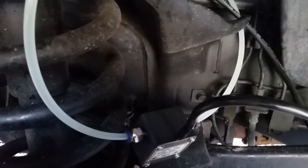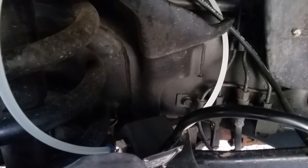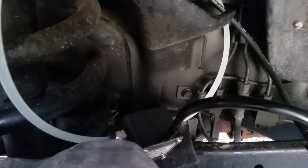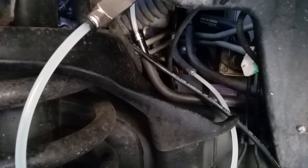You see our flow meter down here. And it's very simple, once you come this far, to just swap this line with the injector with the CP3 return line, and then you can do two tests. Test the CP3 for wear. Also, while you have all these connections made and while you're already plumbed up, it only takes an extra 5 minutes or so to do so. But for our testing purposes, this was very quickly and easily done. You can do this test in less than 30 minutes.